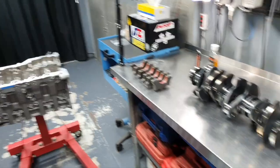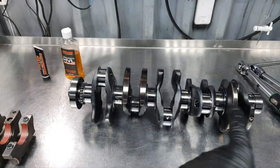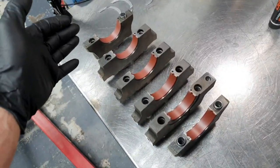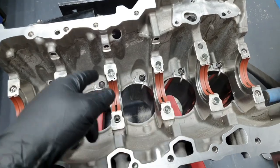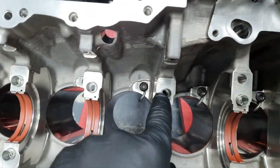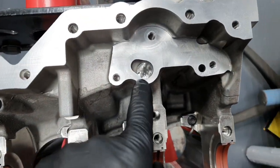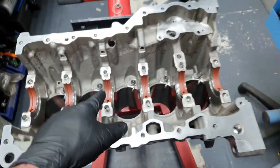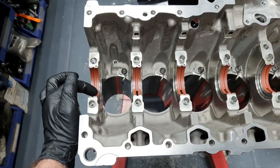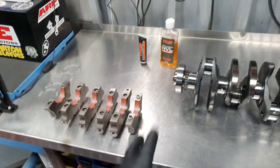Crankshaft. All right. It's been washed, blown with air. Beautiful, excellent. Lower bearings, thrust washers, upper bearings, oil jets, all the threads inside, they're perfectly clean. There is no oil inside, no dirt or anything. Oil galleries looking beautiful. Some assembly grease to block this hole, then high viscosity lubricant, and then place in the crankshaft. Now I have it over there.